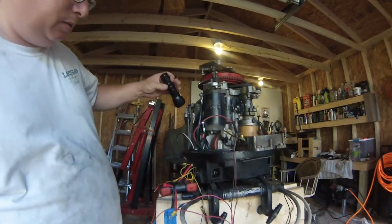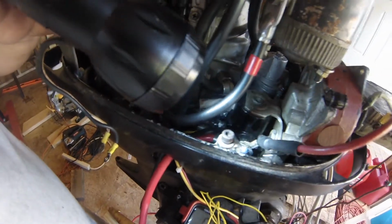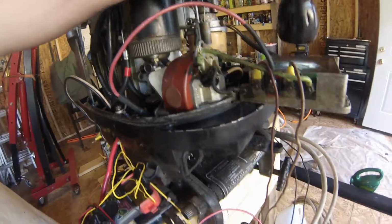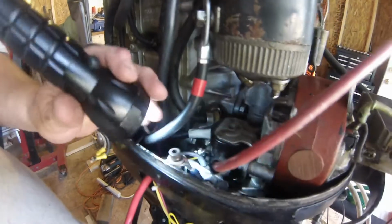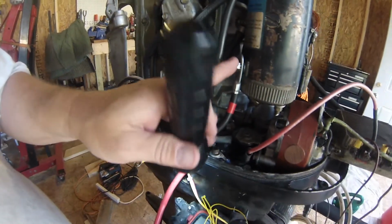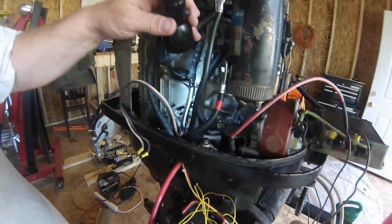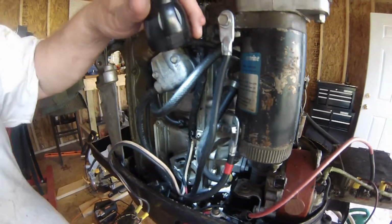Okay, let me show you something. Let me back up. So I'm wiring, got everything on my solenoid right now, and that solenoid is good. And then I've made a red wire. It's going to go up and hit the box that charges the box. So when I hit the yellow, it opens the solenoid, and then it's going to hit the other side of the solenoid, allows the high amperage to flow. So this is my positive, and then my negative lead for my battery is here. So before they had a ground wire that was going to here, and I've checked that continuity and that's good.